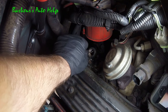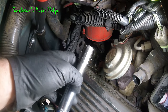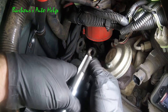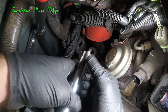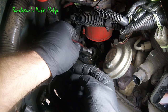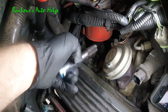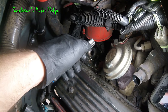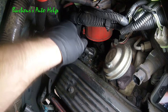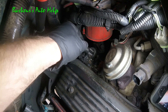I think I've got the threads cleaned up enough to put my tap through and run it down. I'm using the socket on the end of the tap to run it down. If you have some wheel bearing grease or some kind of sticky substance that won't damage the cooling system, put it in these little grooves on the tap. As you twist it in, that grease will pick up debris — anything you chip off the walls will mostly be caught in the grease and you can get it out that way. Unfortunately I didn't have it available to show you, but that is a trick I use at work to keep debris from falling into places I don't want it to go.